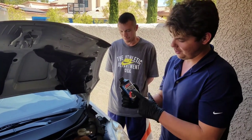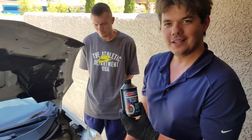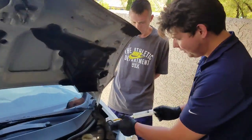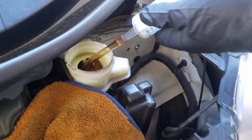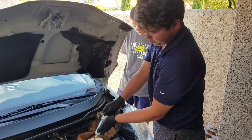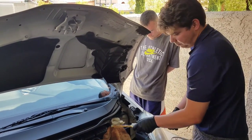The first thing we're doing is our synthetic DOT 3/DOT 4 brake fluid. We're going to be bleeding the brake lines on this 2011 Honda Fit — the sport model with the nice alloy wheels. The first thing we do is go ahead and suck out the old fluid. You'll see that old grayish brake fluid; you come with an extraction pump and just suck it all out. Just suck out as much as you can. Then we'll put in fresh fluid and bleed the whole brake system.